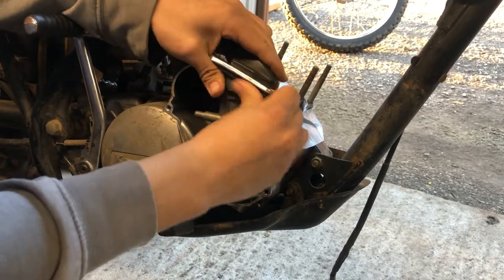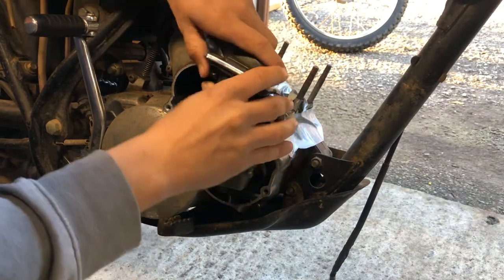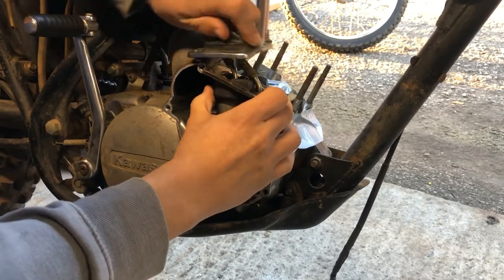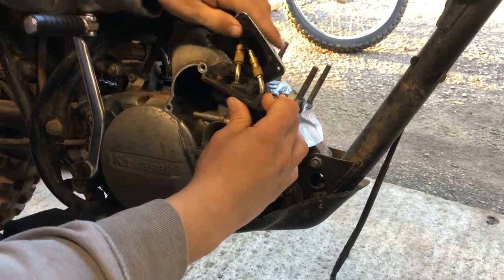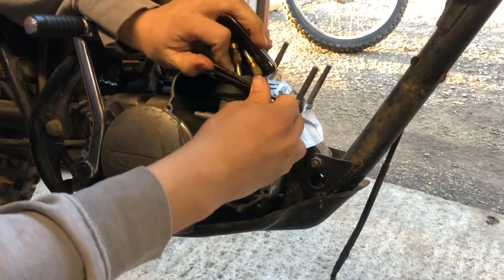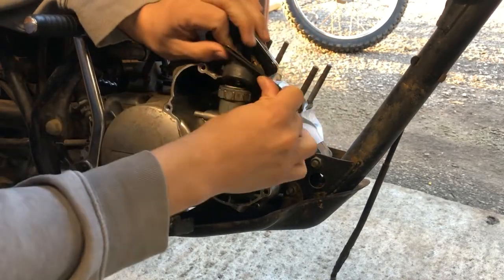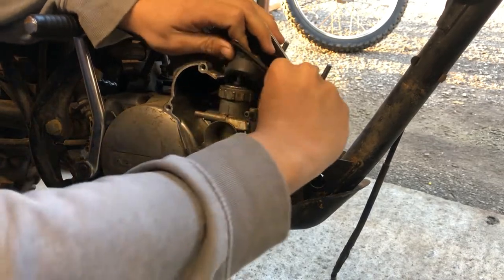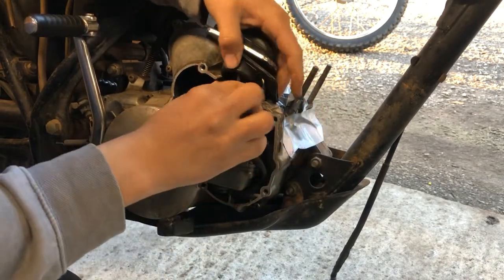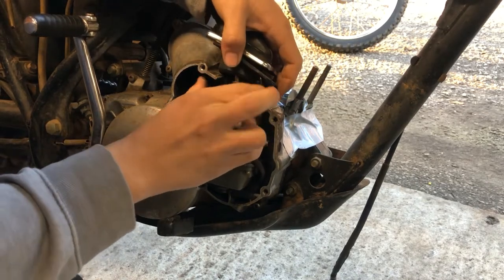So, let's see what the deal is with these hoses, or the throttle cables. Let's pull this up very carefully. Slide that up. Okay. So here are our throttle cables. Let's see if we can throttle and choke. Will this slide up anymore? Because you're going to want to just pull the slide off, or out, to get the throttle cable out. But the choke, I'm not entirely sure.